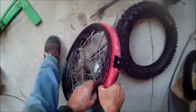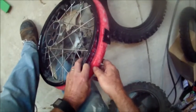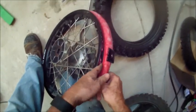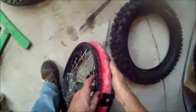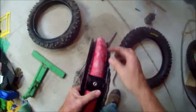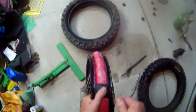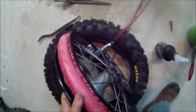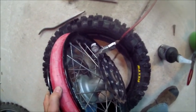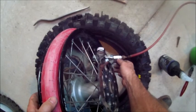So underneath this red tube, you've got something almost like a bicycle tube but heavy duty. This is their special tape that you wrap the rim with. You've got an inner tube inside of this. I could just take a tire iron and pop this whole thing right over the rim. To get air into the tire chamber, it's one valve, and then the other valve fills up the inner tube on the inside. Let me air this guy up — it'll take a couple seconds to get the full 125 PSI in there. It's literally like a pinhole-size orifice.